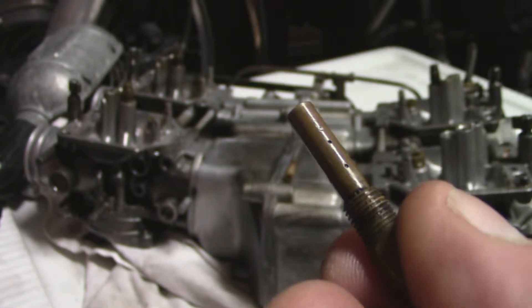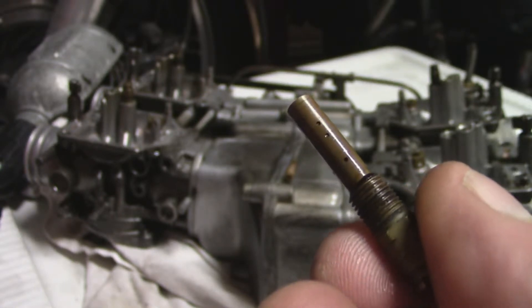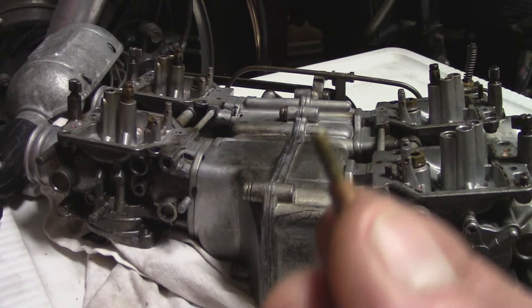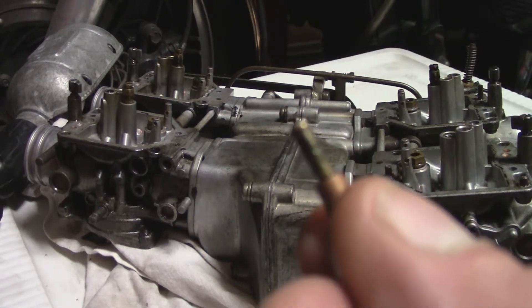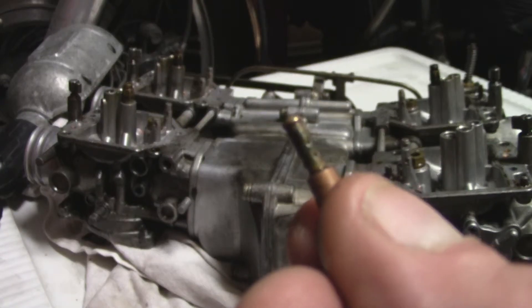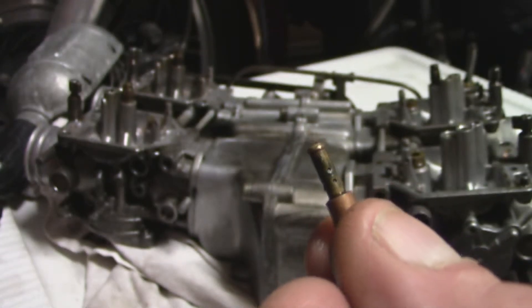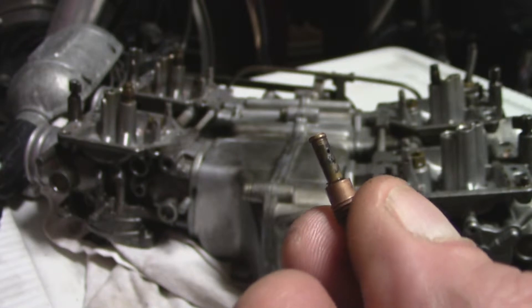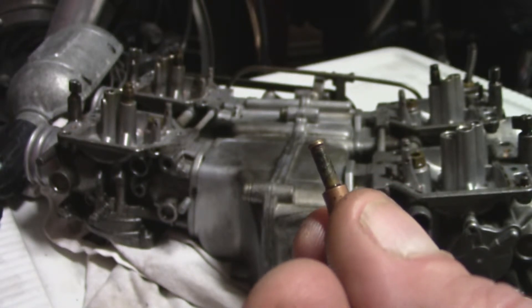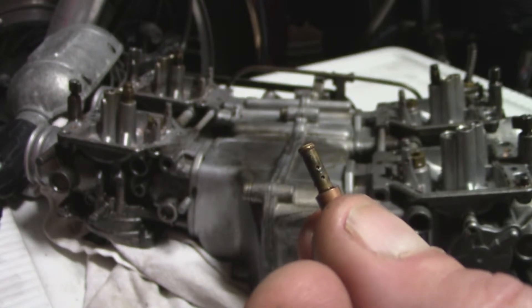Not that bad — I have just wiped it across my fingers to get the scale off the top. That one was more like this, more like the idle jet. And this one's completely clogged.